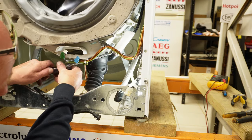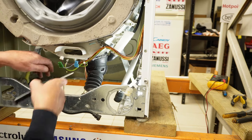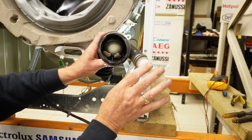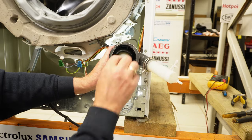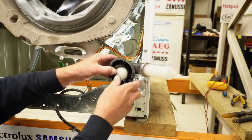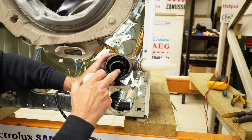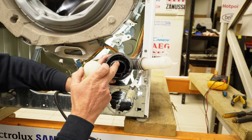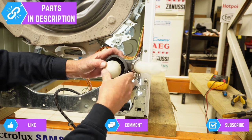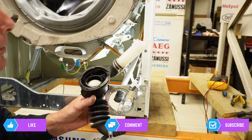Press the clip down at the back to loosen it, then use a Torx 20 on the screw until it's nice and loose, and drop the hose down and pull it away. In here you can see calcium again which has come off the machine from all the shaking. Inside here is the anti-siphon ball, and in this area it can actually build up with clothing fabric, all sorts of things like plastic left in pockets and so on — this can cause problems with the machine not being able to empty. But that's a very good sump hose for someone in the future.